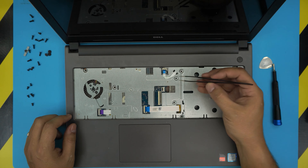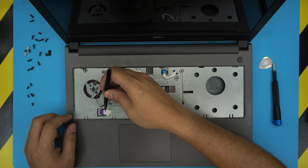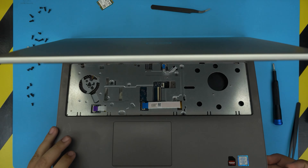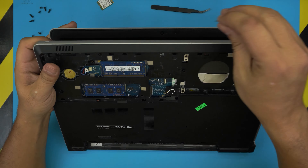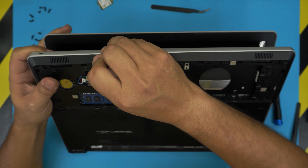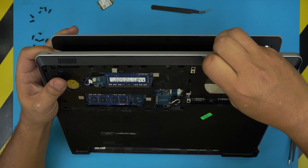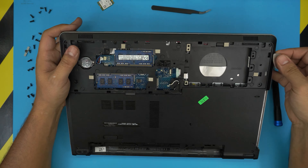Unhook this cable upward and the power-on button cable. Loosen up the cable connectors and the trackpad cable. Grab your guitar pick, bring it on the bottom side between the bottom and top cover, wiggle it around, stick it in and twist it to release the bottom cover.